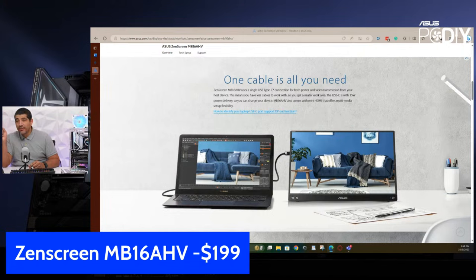But if you use the USB-C, not all USB-C ports inherently support display alt mode, especially mobile devices. So if you have a phone, you need to actually check to make sure that it supports DP alt output, okay? Because there are some people who say, I plug this in and it doesn't work, and generally it's a situation where their device doesn't support that. So you do want to check the documentation for your device, okay?